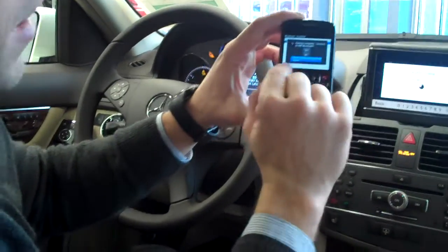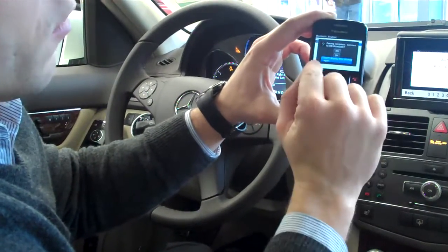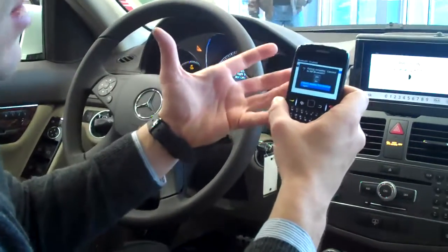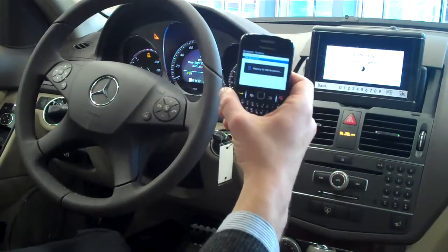You want to hit yes. But there is also a message down here: 'Don't display this prompt again.' If you select that so the little box is checked, then every time you get in the car your phone will automatically connect. If that is not selected, then it's going to ask you permission every time you get into the car.